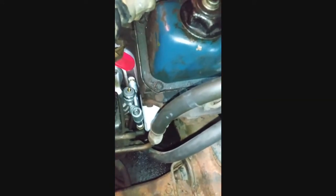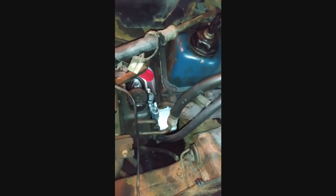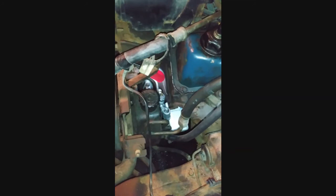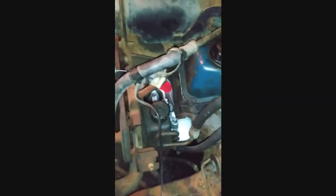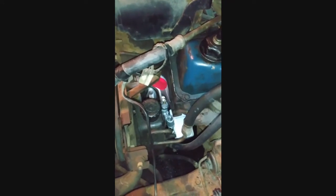All the while, it's leaking a tremendous amount of power steering fluid. Not from that, it's from the steering box, which in these Fords, you can see that down there. It's in the back. Never had that problem before, so it's just one more thing that I tackle next year. Put some cat litter or cardboard underneath the car. For the time being, still drives fine. Power steering isn't affected yet, but gotta get that done sooner or later.